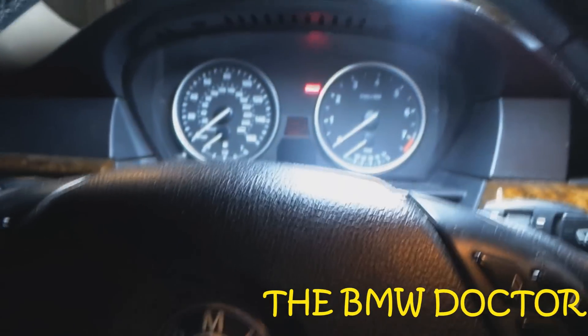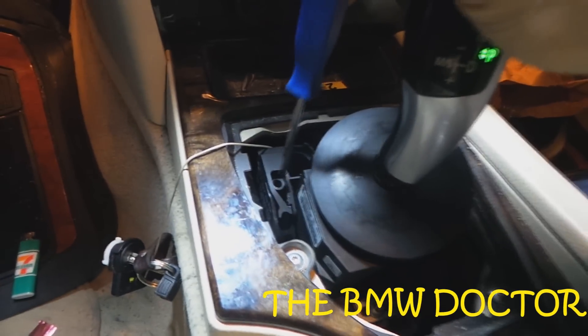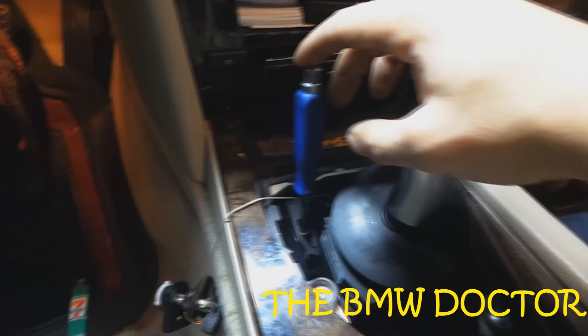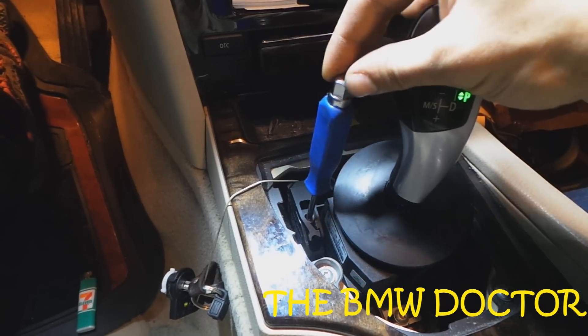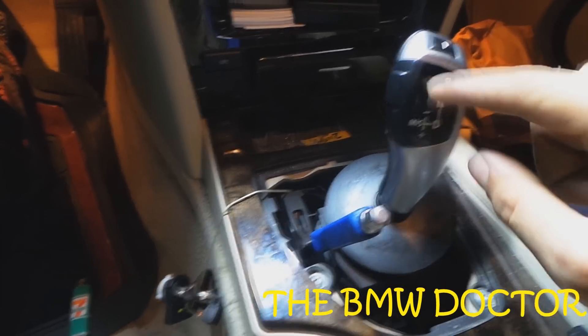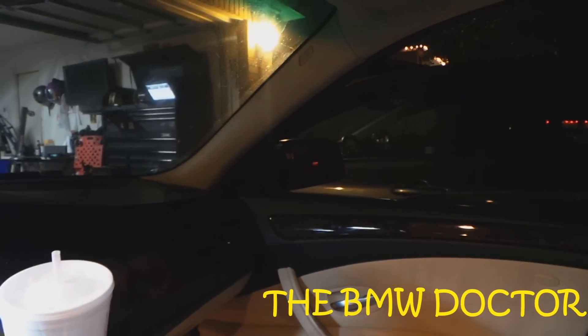You can't do it unless the car is starting — if you do it right now nothing happens. Even if you turn the key on and try to put it in neutral, nothing happens. So what you do is get a screwdriver and put it in here — just a small Phillips, just enough to fit. Keep your foot on the brake because it's going to disengage the transmission, and you go down. Did you hear that? See, now it's in neutral. If you keep the screwdriver there and let go of the brake — voila, we're moving!